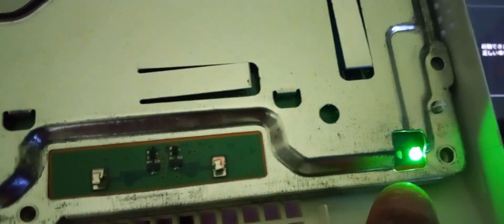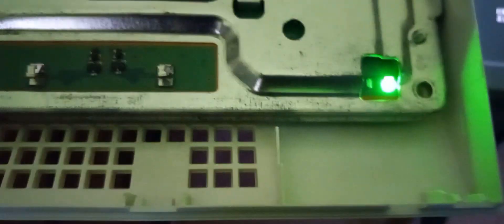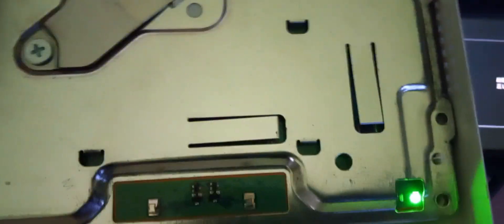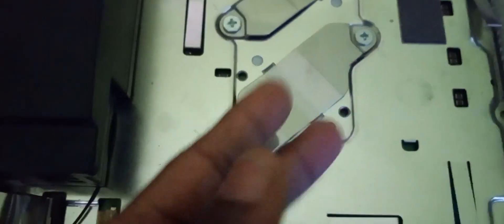If your PlayStation 3 is green for a little bit then does the yellow then blinking red, that tells you something is up with it. But if it's a quick immediate yellow then blinking red, that'll be something further. If you guys like this video, thumbs it up, comment down below, and I'll see you guys in the next video — peace out.